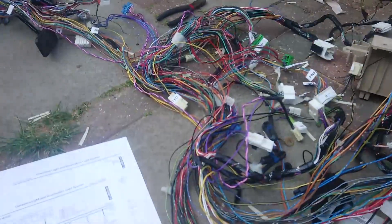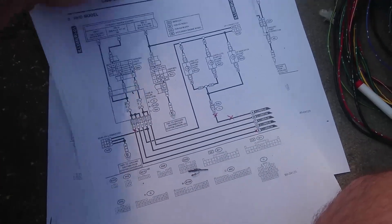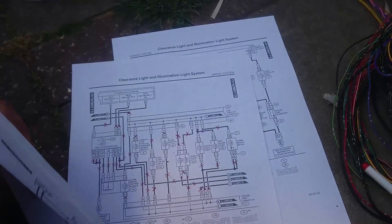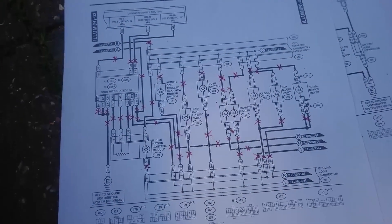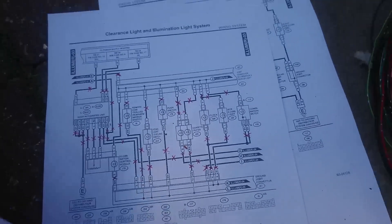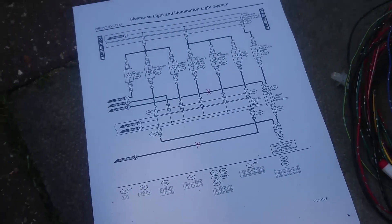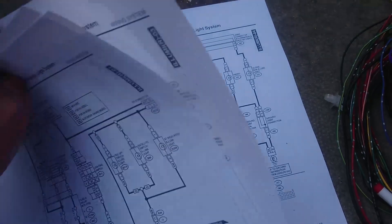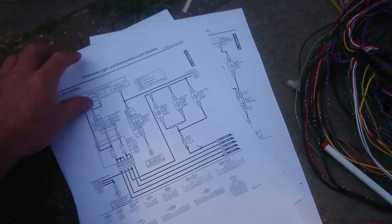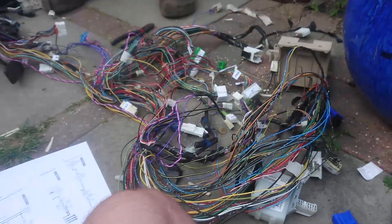We're about four or five hours in and we've only removed that many wires, so this is going to take a while. But we know what everything is. We're just gonna continue working our way through the wiring diagrams. We're on the clearance light illumination system — there's four pages of diagrams for this, and I'm just putting red crosses on the wires that we've removed as we remove them. We've done that page now and just have these three other pages. There's a couple of wires from that one that have already gone because they linked on. So we've just got three more pages to do on this and then that's the dash light system gone. We're just gonna do the same for all the circuits we don't need. It's definitely time-consuming.